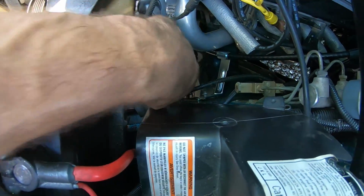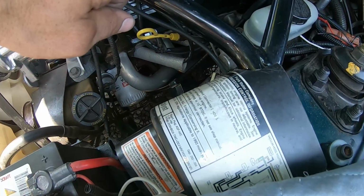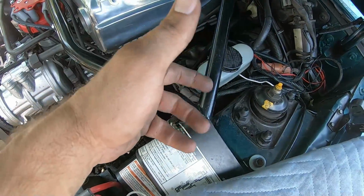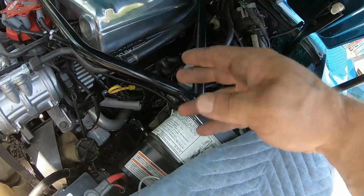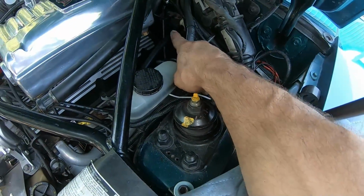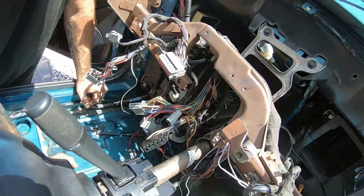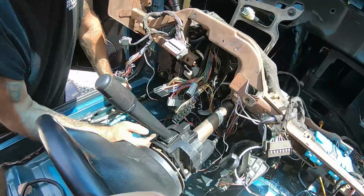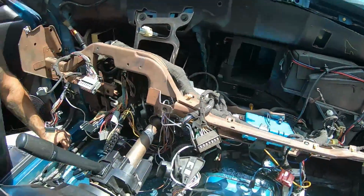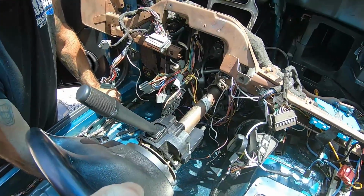And I've routed the cable underneath of the motor mount, which will go straight back to the bell housing, get clipped in, and then I can make an adjustment from down underneath at the fork. So that will all be done. Now we've already, like I said, moved the VSS cable over to the next grommet for the cluster. You guys can see how in-depth we go when we decided to do a T5 swap. I mean, we got this stuff ripped out like we're parting it out, but we've parted out cars for so long that we know where everything goes.